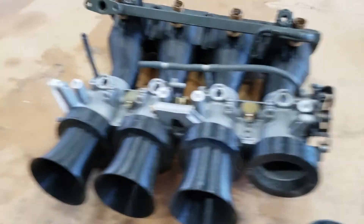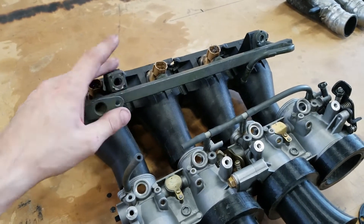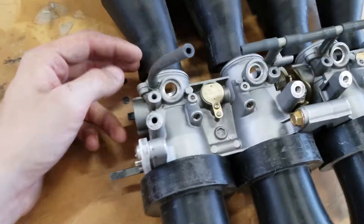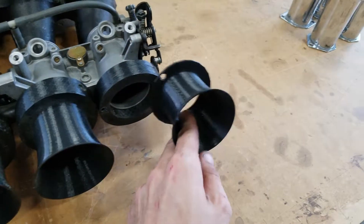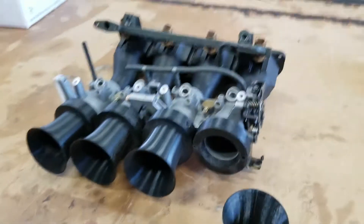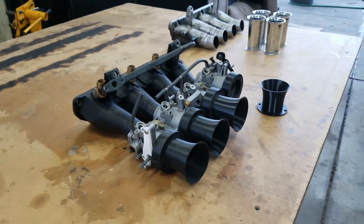This is a simple representation of pretty much what's on my car currently: carbon fiber nylon manifold with 1.6 injectors, stock 1.6 fuel rail bolted to the manifold, GSXR 750 throttle bodies, silicone couplers, press-fit adapter pieces, a throttle cable bracket, and a little IAT adapter. It's a fundamentally really, really simple setup.